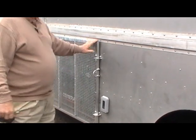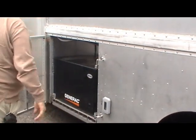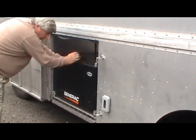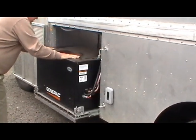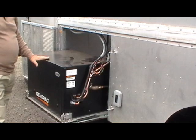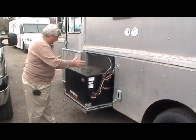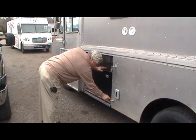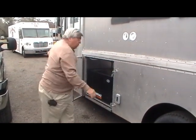We build a cage in the front all for ventilation, to let the thing breathe. We've got two locks. You open the generator door — it's a Generac RV unit. Pull these two pins and the generator comes right out at you so you can get in and service it. This generator is hooked up with a remote start system from the inside, which we'll show you. You just push it back in its slot, run your two pins in, close the door, and go about your business.